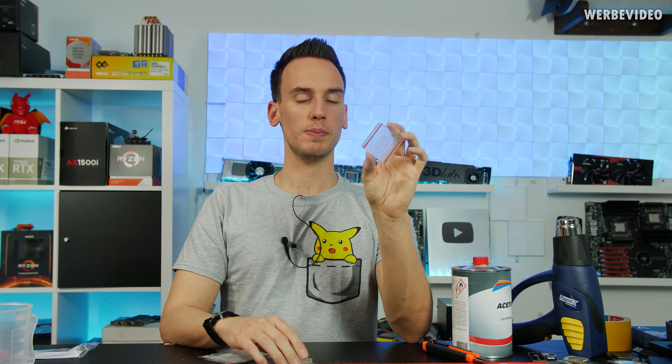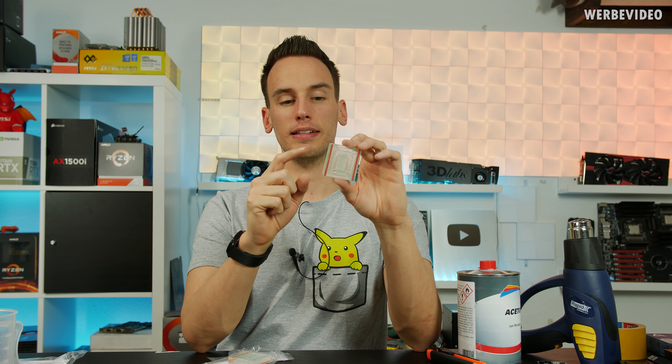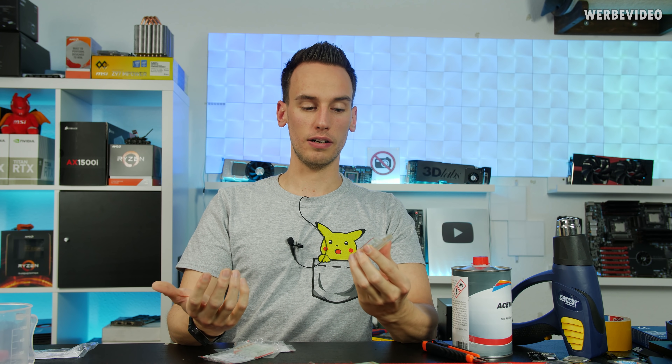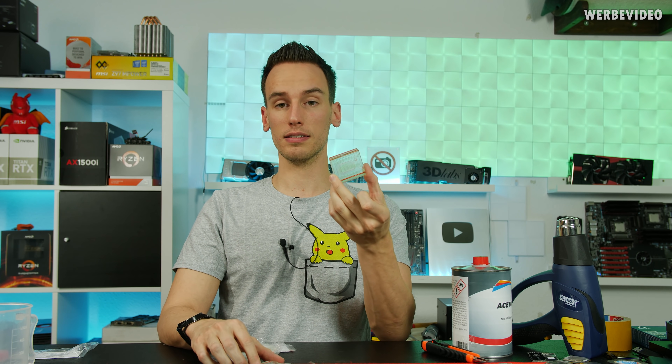The die tool especially is made really nicely. The scale itself is a very nice idea but not entirely accurate — getting your zero is a little bit difficult because you start on the die in the center due to the convex shape. On the IHS the IHS is constantly being lapped while you're still trying to remove the outer parts of the acrylic, making it even harder to get your zero accurate. If you have a precise measurement device, you can use the scale and rely on it; otherwise relying just on the scale itself might be difficult. The die version is nice and can be used very well. The IHS version, considering it scratches your IHS, is not that great. Thanks for joining in and see you next time, bye.